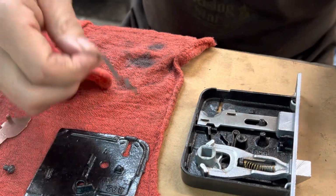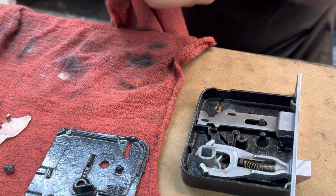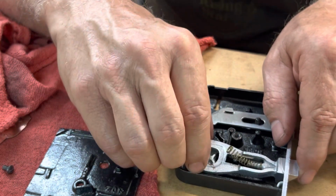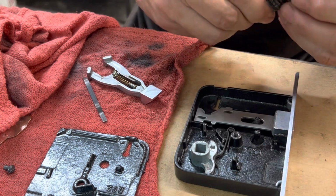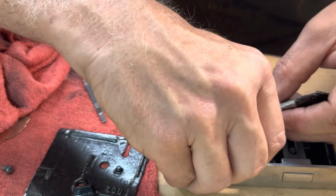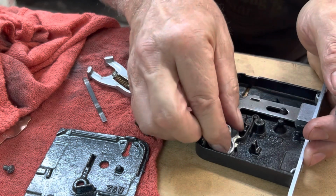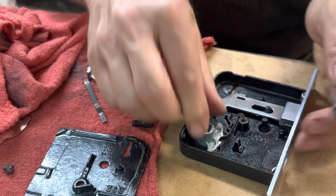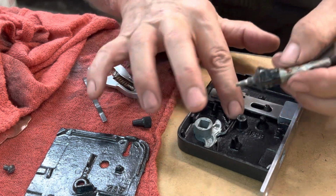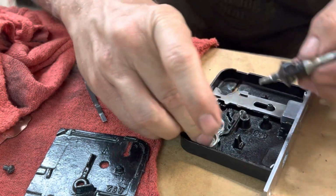And then the last part of the mechanism is this part right here, and this is a spring action as well. Lithium underneath this setup here before I install it, because it's just easier with it out. Go ahead and put that in the contact point. There we go. That's what we want to do. And we'll go ahead and lubricate it at the next contact point. Right there. Work that in.